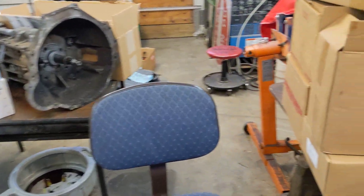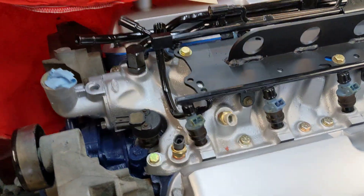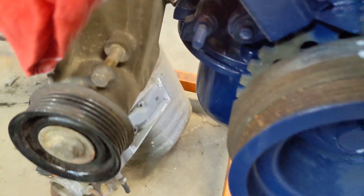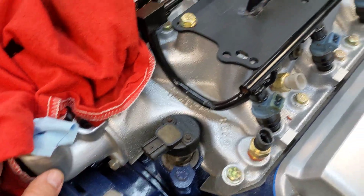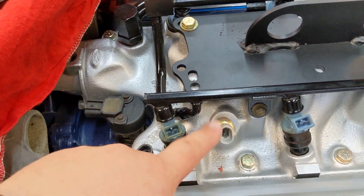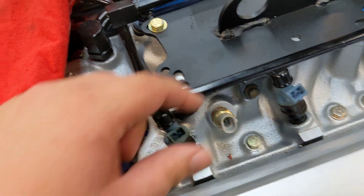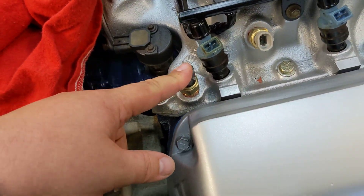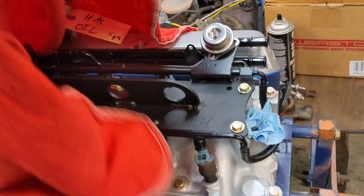So anyway, the Mustang stuff is coming together. Here's what's going on — nice little 302 setup, running the Explorer crank pickup. I don't even know if I'm going to use this, but it's at least filling the hole and running the oil pump, so I need to have it. Then 24-pound injectors. I've already drilled and tapped for the 3/8 NPT for the intake air temp — sorry, this is actually in the air path — and this is the coolant temp here. So I'll have my sensor hookup over here for my gauge. Should be good, pretty simple straightforward setup.